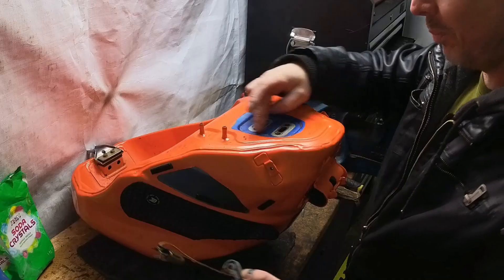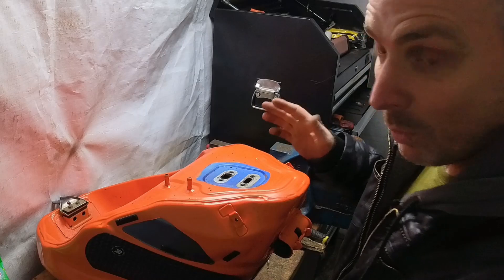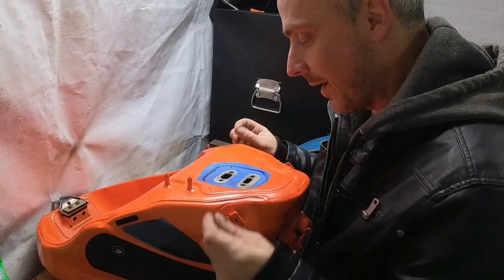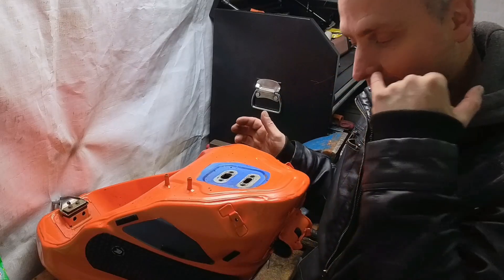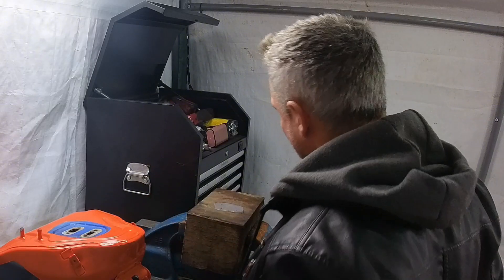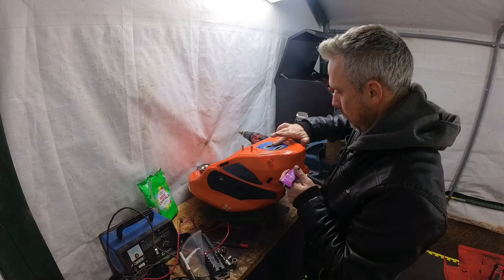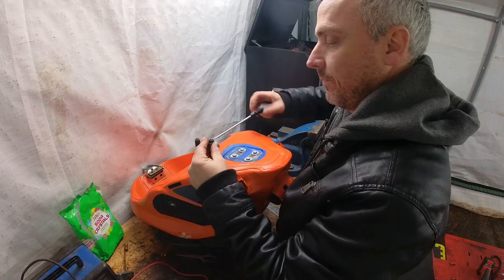What we're going to do is make a little plate, drill some holes, bolt that in place with a bit of silicone sealant so the water doesn't come out, block everything up, make sure it's not going to leak. I'm just going to use a step drill. I've used a couple of bits of old fuel pipe and some M6 bolts just to seal up those fuel feeds.